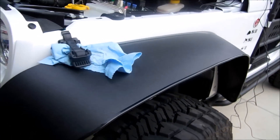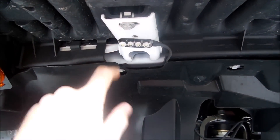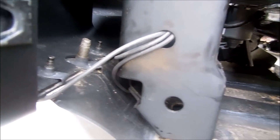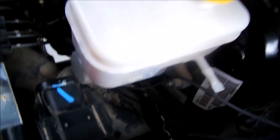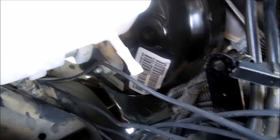On the driver's side, the light is in the same location on the fender flare bracket. You can see the wires coming across - two from the passenger side and one for the front driver's side bumper - running up underneath the body mount and across the frame. They'll tuck back up and find a location right behind the shock bracket. We removed the horn so we can get easy access to the wires coming up through the engine bay.